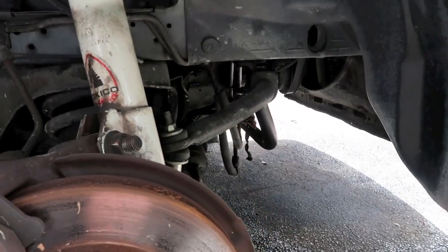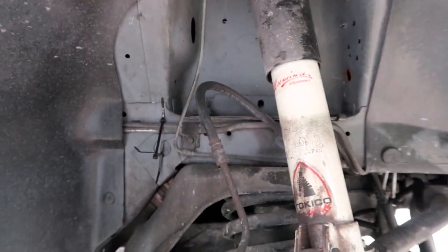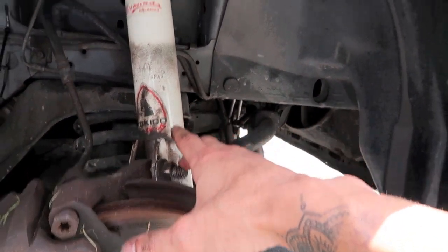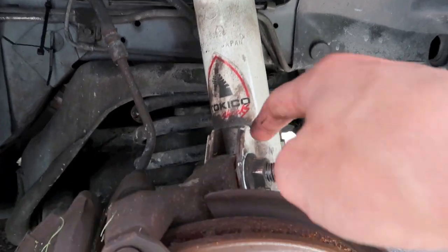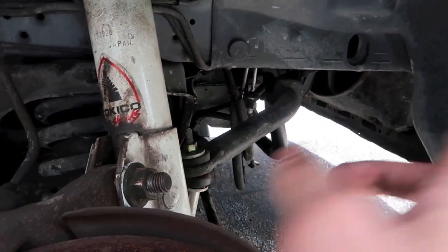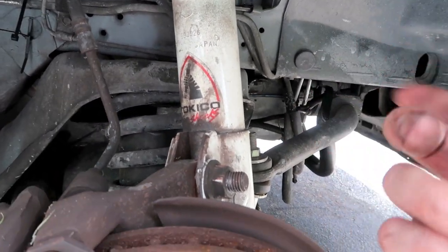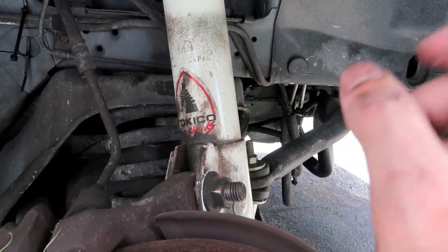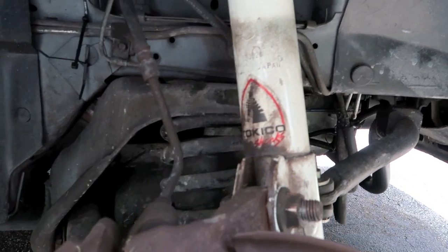All right guys, we're back. I took a little break and I feel much better. My shirt is still completely drenched, but I went ahead and already got the car jacked up and the tire off. So the next step is going to be, just like the other side, take the nut off the sway bar, then remove the caliper. I already got the zip ties here ready to suspend it. On this side I'm noticing the shock bolts and nuts are in the opposite orientation from the other side. These aren't stock, so obviously someone changed the shocks and didn't put these bolts back the way they're supposed to be. That side's already done and I am way too tired to take it apart to redo it, so when I put this one back together I'm just going to do it so they're both the same on both sides.